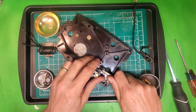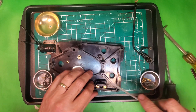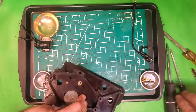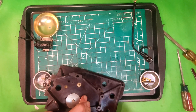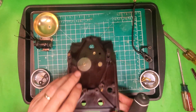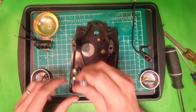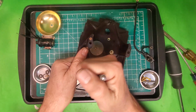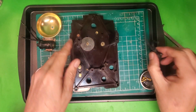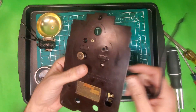Something I failed to mention is the alarm switch. What I do with the alarm switch — and again, you can ask legitimately whether that needs to be done — is I take off the ends of the wires, the terminals, and then I put heat shrink over the old wires. Then I resolder on the terminal ends. Does that have to be done? Probably not, but I do it anyway. Then I take the liquid tape and put it at the ends right here where the terminals meet. So now I've got the name plate on there and the switch plate in there.